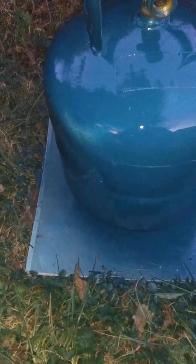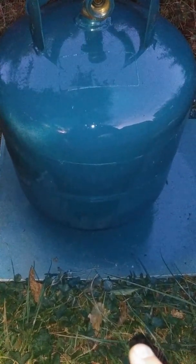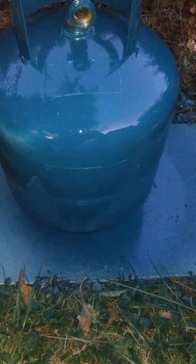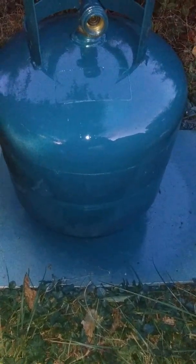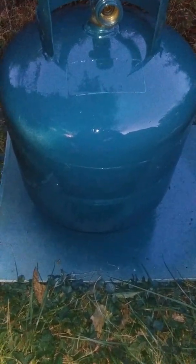Again, consistency is the key. You want to keep a light touch on the sprayer. You want to lift your finger as you get down to the end of where you're going. You also don't want to spray in too large of an area. So as you're spraying, I'm not going to spray the whole thing in a big circle. I'm going to do section by section.